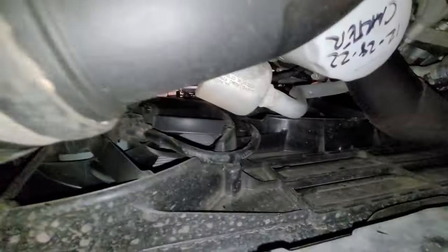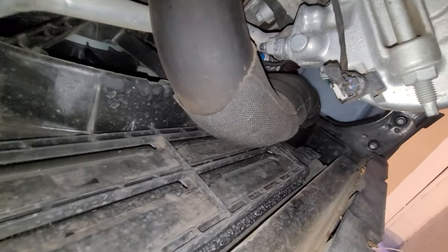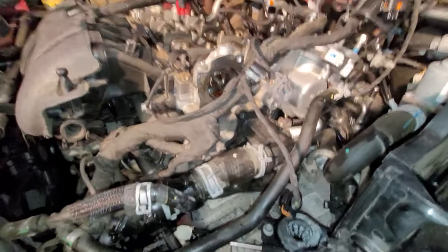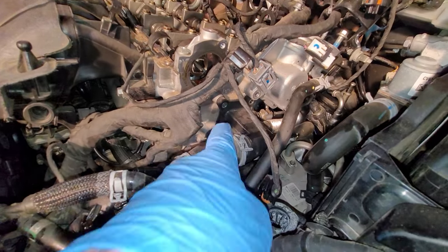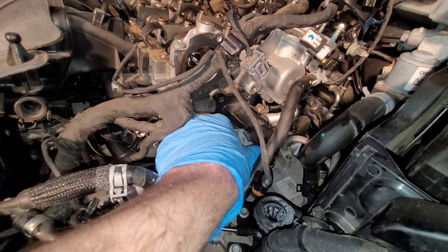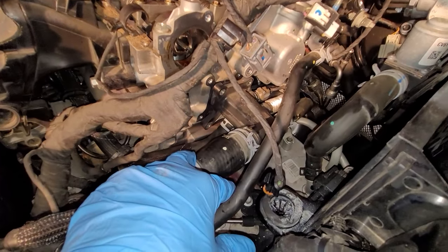And there's really no good radiator drain. I don't think I can really even film up here. There's just no plug. I thought I read that there was a plug underneath here, but I am just not seeing it. Just not seeing a drain plug on the bottom of this radiator. So, we're going to do this the messy way. In effort to take off as little as possible, this water outlet pipe is going to have to come off to get the cylinder head off, so I'm just unbolting that. Let's drain it that way.